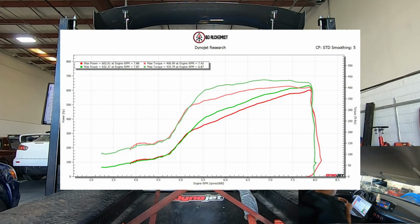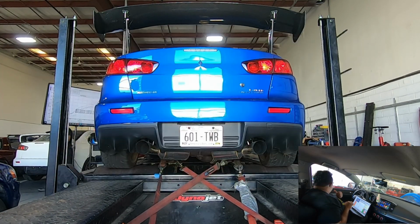And now I can talk about the spool. I'm not even trying, and it's hitting whatever I'm throwing at it so far, 32 PSI, at around 55. But let's see if that stays with the higher boost level. For the V-band, yep, the ECU one is before the V-band. Okay, because this one's reading 10.5, this one's reading 11.5.